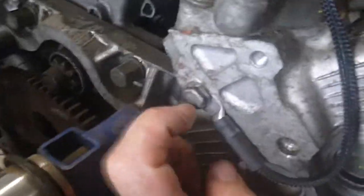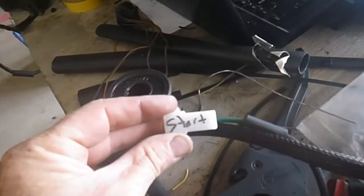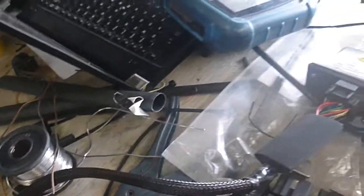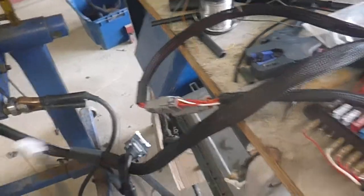So vacuum line. There will be a MAP sensor to mount out by the throttle body area in the air box, and the ignition module — so you need to do that as well. On the back of the engine — two earths: one on one side of the head, one on the other side of the head. There's a green wire — I'm going to go around the other side. So looking at your loom, here's a big green wire and I wrote 'start' on it. So if you need a start circuit to run into the engine bay, there it is. If you want to cut it down, just cut it off, shrink it, put another terminal on it — I've given you some spare terminals.